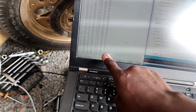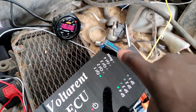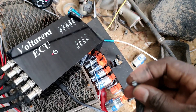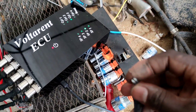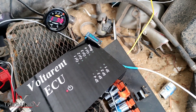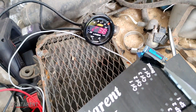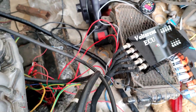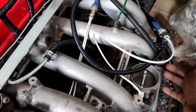900 RPM at idle, and right now we are in economy mode. I can change the drive mode using this dial — so if I change it, it goes to comfort; if I proceed further, it goes to sport. But right now I'm just testing economy. You can see the AFR values right there — it's between 15 and 16 during idle. You don't want it to be rich whatsoever.